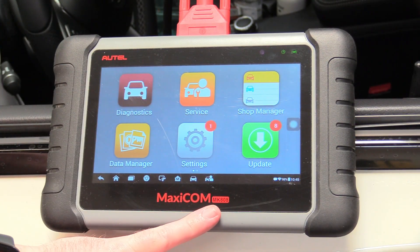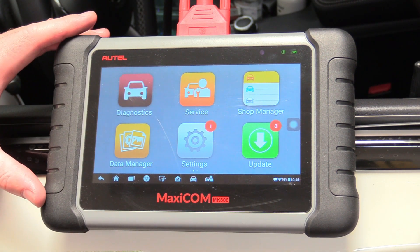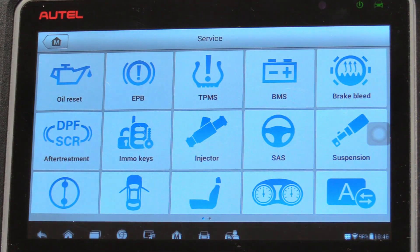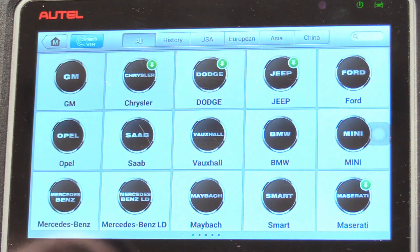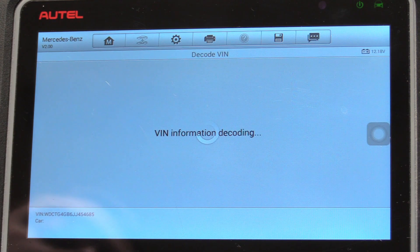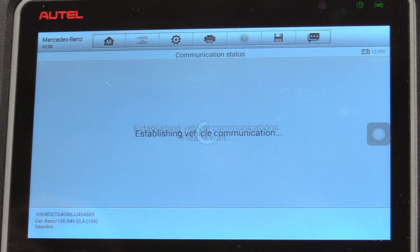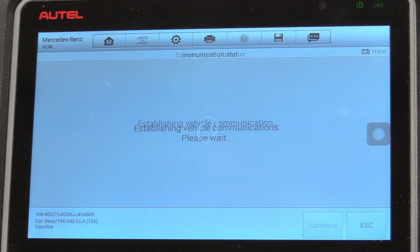What I have here is my Autel Maxicom MK808 — it is not the newest scanner available. I believe they make a 908 right now, and I will leave a link down below in the description to this unit and the updated unit. This scanner is about $500, but with modern vehicles you're going to have to spend the money on this; there's really no way around it. We can see our screen and we can select Service, then Oil Reset. I like to do the VIN search in the top left where it auto-detects, so it searches and makes sure that what we're working on is exactly what the computer knows we're working on — down to the VIN number, not just make and model. There's our VIN number; we can hit OK. It's going to decode that information and tell us exactly what engine and transmission this particular Mercedes has and whether it's an AMG or not. We hit OK, verify that information, hit yes. We can select instrument cluster, which is what we need to access to tell it that the service has been done.